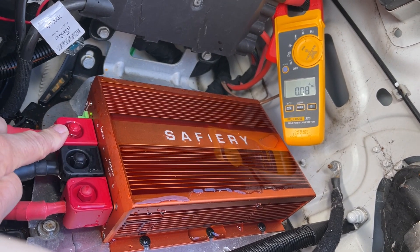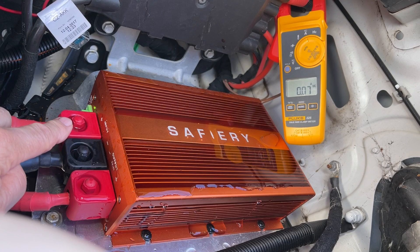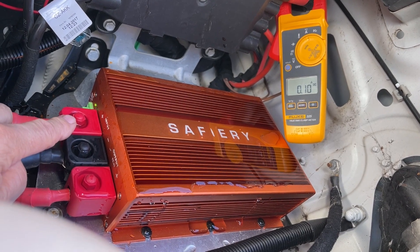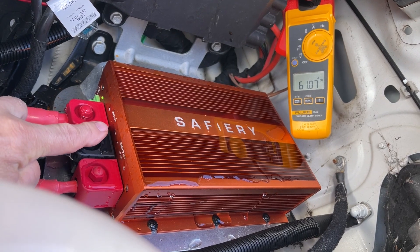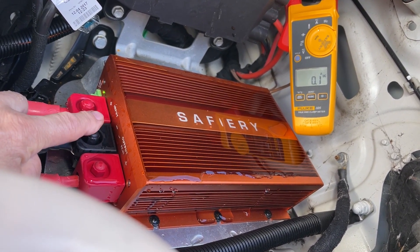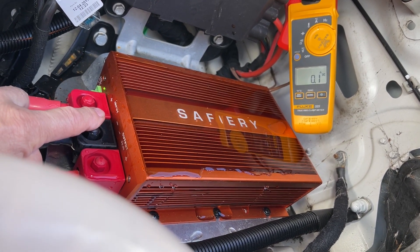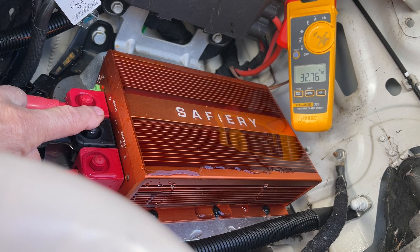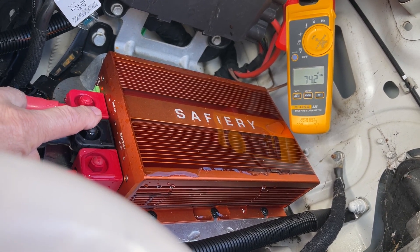We'll just do one more start up. And you'll see when we start up again, the smart alternators are a bit tricky to pull the power out. I've got a delay — I've got exactly the same strategy on this that I have on Scotty, in how we do what I call sticky pen. It'll take two or three times from start up for the smart alternator to kick in and hold. And that's it there — kicking in and hold.